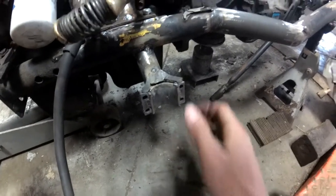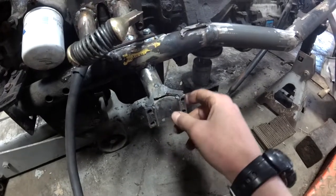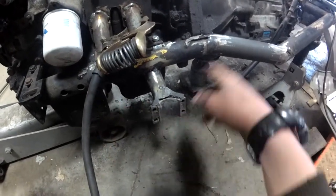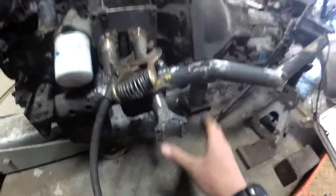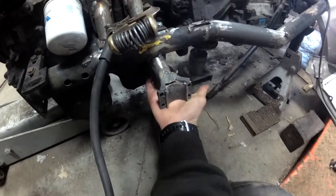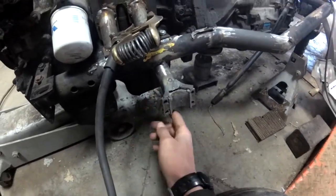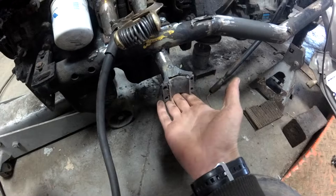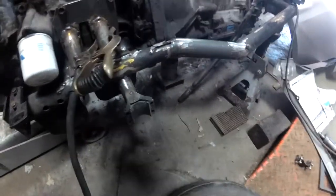This tubing here isn't going to be the only thing holding the front end together — that wouldn't be enough. There's going to be tubing that comes off like that, so it's basically a triangle. If you hit something or back into something and the tire catches, it's not going to bend. There'll also be a big tube that goes straight across to the other mount. I'm going to work around the oil pan — there's enough gap there — and everything will be strong.